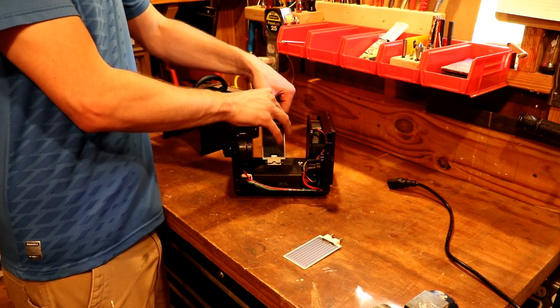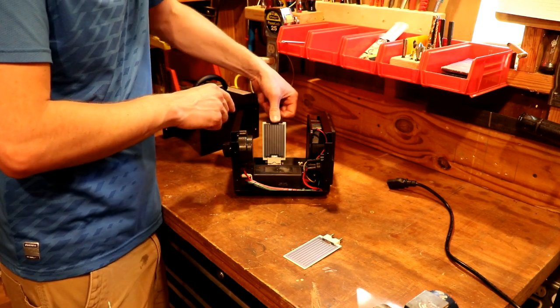Make sure it's clipped back in. Now you might have noticed that only about half of the plate was lit up. If you've done any reading, you'll know that ozone generators are often talked about as not being as effective in humid conditions — that's very true, mainly for the corona discharge models. UV light ozone generators are not affected by humidity, but just as static electricity is less prevalent in a humid environment, the corona discharge effect is not going to be as strong either. Today it's about 85-90% humidity from a lot of rain this summer, so only about half the plate is lit up. If I were actually trying to remove a smell from a room, I'd wait for a drier day or go rent a commercial unit.